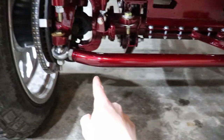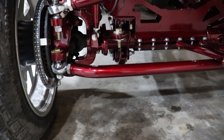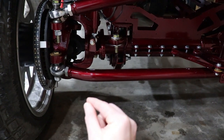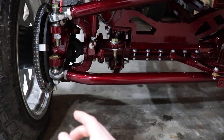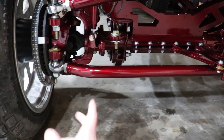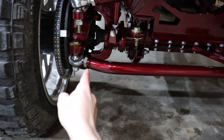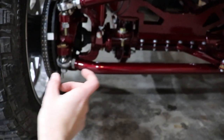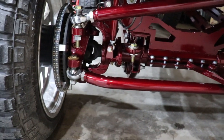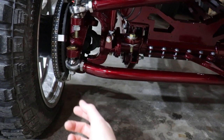And we done that in a Harbor Freight pipe bender. We heated it up and bent it. I wanna say it was like 12 pumps. We done like 7 pumps, and then we moved it like 1 inch, and then we done another 4 or 5 pumps on the bender, and that gave us an absolutely perfect bend. And we actually bent it with that tube a lot longer, and then we cut it. So then the bend was over here on the edge. See, it's just personal preference, guys. You can put those bends wherever you want, as long as it has them in it. And I have even seen people run straight tie rod bars, and they use the 7/8 offset Heim joints.